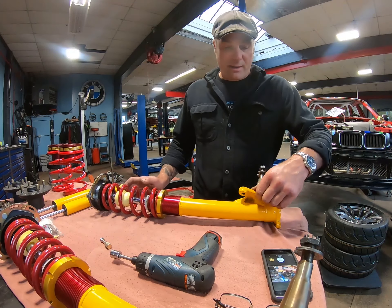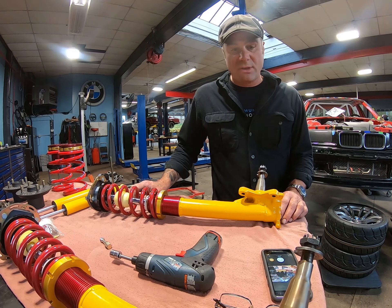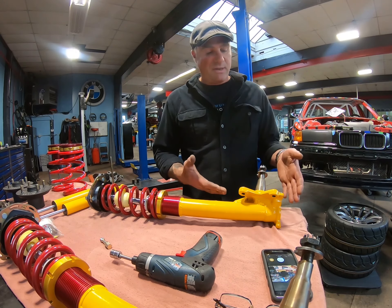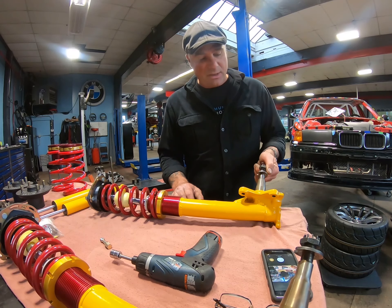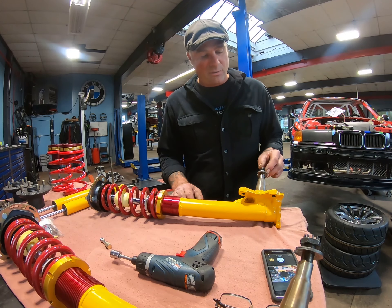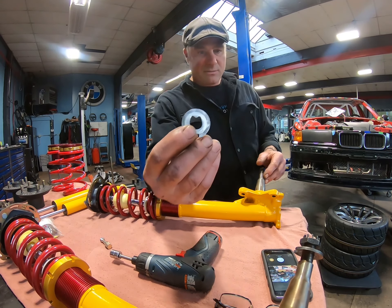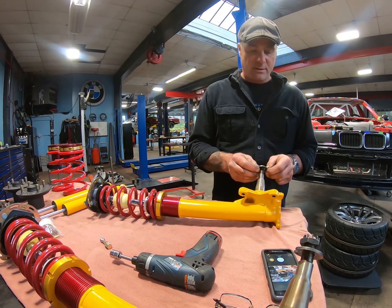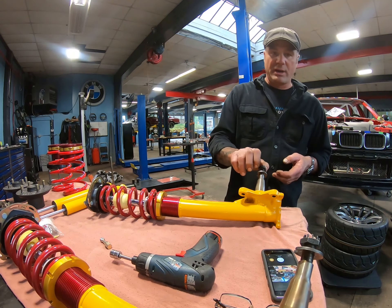When they come back from powder coat, the first thing to do is go through and clean up all the threads, and that's what I was going to do tonight getting ready to hang the suspension in the car, which will hopefully happen tomorrow or perhaps Saturday. We're going to prep this stuff for installation. I was cleaning up the stub axle threads — nothing really wrong with them but I go at it with a wire brush, clean the threads up, sometimes put a thread file on it, test fit the thrust washer which has a real tight keyway that fits in a groove on the stub axle — make sure that all fits nice and tight and smooth.